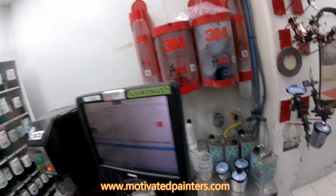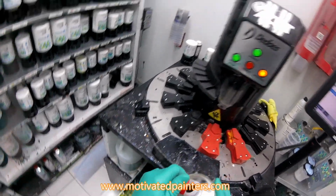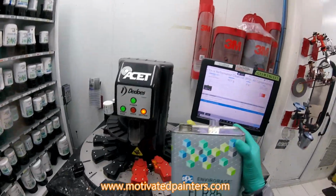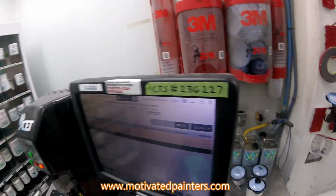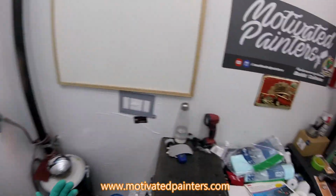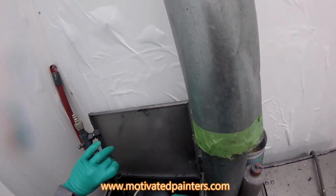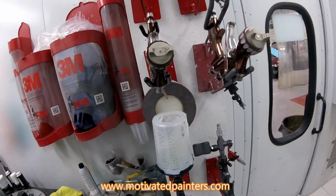and like I said in the previous video, in the summer when it was really hot, I was using ECR 98. Now it's a little bit cooler, so I'm using ECR 85, high temp reducer. And what I've been doing is just over reducing it. So if I mix 30 ounces, I'll put 30 grams extra. If I mix 20 ounces, I'll put 20 grams extra. And it's been working so well. The shine holds up better. The finish is better. You get a nicer flow. So I'm really enjoying it. Sometimes EC530 gets some dieback or solvent pop, and this has been able to eliminate it. So maybe give it a shot.